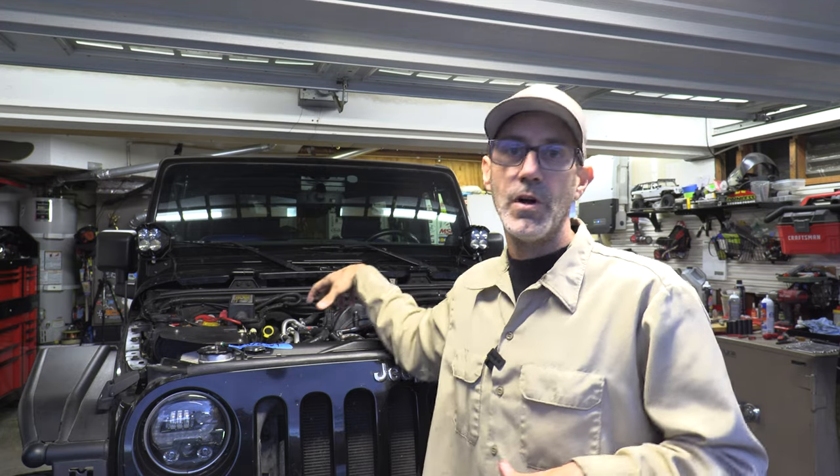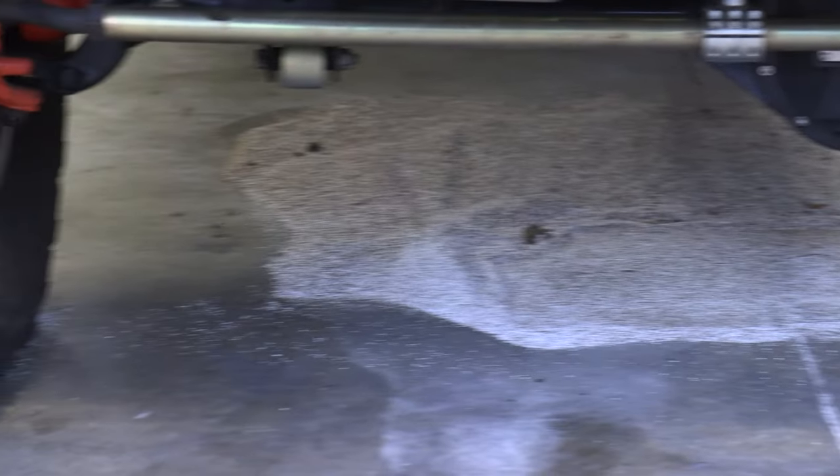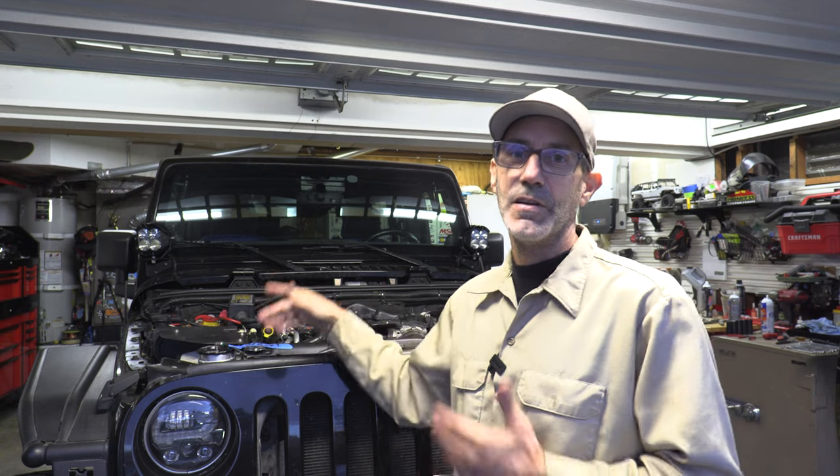Well, I'm having a really bad night. I went to start it after putting some oil in just to get some oil circulation — I was excited — and the oil light came on immediately. I heard gushing from underneath; it filled up the galley with oil and literally puked all the oil out. One of the seals or sensors must have blown out, so it's time to go all the way back in there. I even used my endoscope and sure enough the galley is filled with fresh pristine oil in that really clean galley we just spent all that time cleaning. Ouch. Let's go back in — but not tonight.